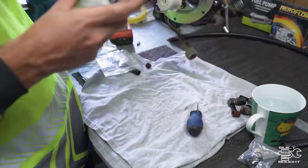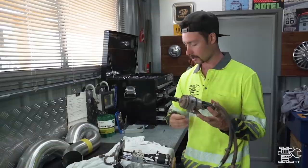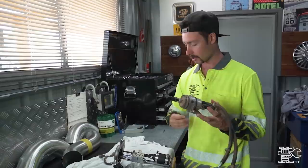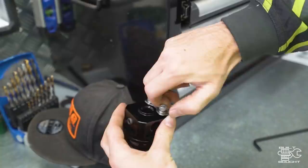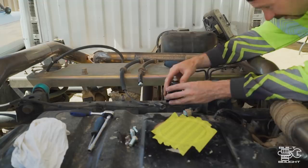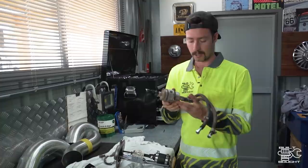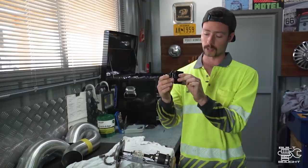So this is the regulator I've pulled out — something I got from the US, it's a filter-slash-regulator that automatically regulates pressure. But that only works off a standard pressure pump; it's not going to handle this high-pressure pump with the amount of flow going through. So I've got this new Aeroflow one. I'm going to have to flatten out this little bracket so it sits straight in the right position where we can get all the connections and fittings onto it. I'm going to replace all the fuel hose and might as well put an inline filter in as well since this new one has no filtration — it's purely regulating.